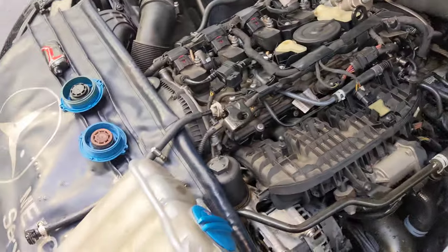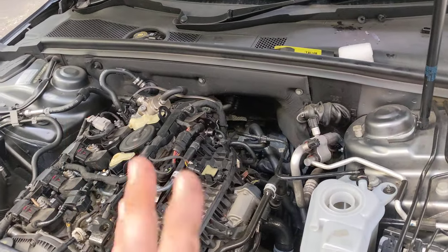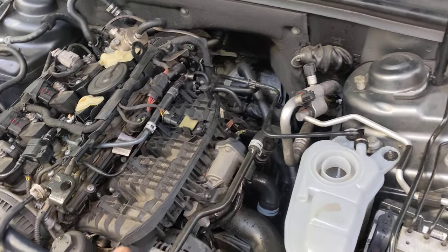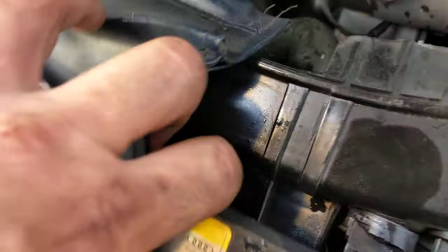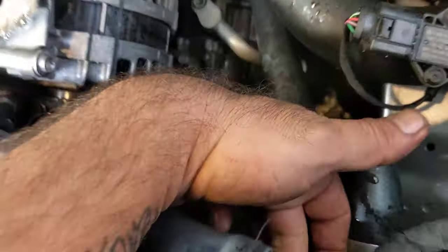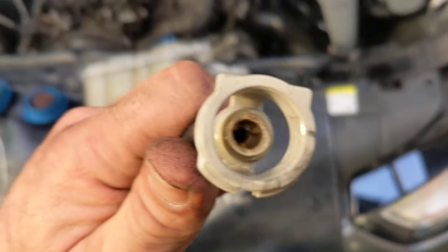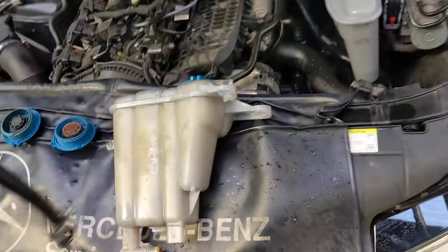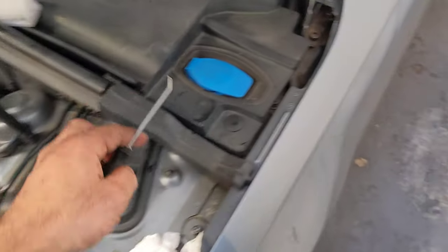In many Audis, there's a silica bag built into the coolant tank that can burst and also give you brown coolant. It's not like a Japanese car where you just change one or two hoses and you're done. When you're removing your broken pieces from the radiator, remove these two clips and access it from there. When you remove this hose, that piece is very tight inside and it disintegrates and actually blocks that area too. You want to use this tool to get it out very patiently.